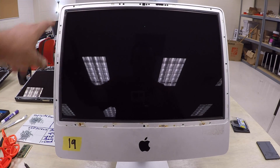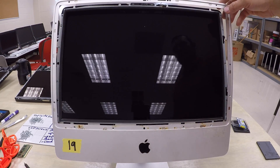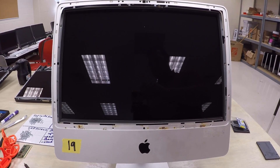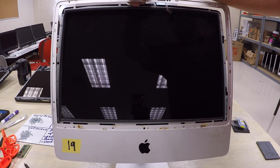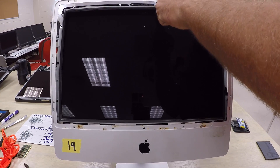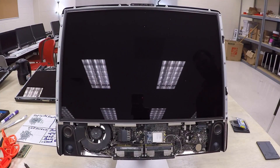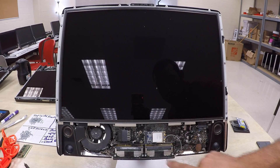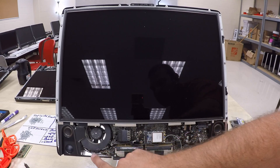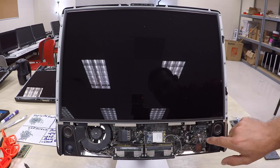Gently put your thumbs on the foam on each side and pull on the panel with your index fingers until it pops out. There is a microphone cable at the top — disconnect it by holding the black cable and pulling on the tape. Then grab both sides of the faceplate and gently pull it towards you. You can now see the logic board, the two RAM modules, the airport/wireless chipset, the fan, speakers, CMOS battery, and the main logic board.